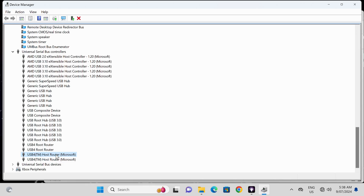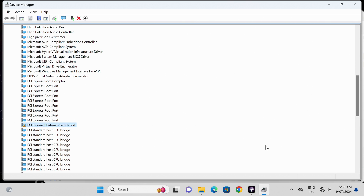This is the part where I'd show you the mini with an eGPU, but like the recent GMK Tech M6, I couldn't get it to work — with the same code 10 error. I've managed to get an eGPU working on every other mini with a USB 4 or Thunderbolt port reviewed on this channel, except for these two. Maybe they're not 40 gigabit compliant.